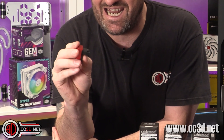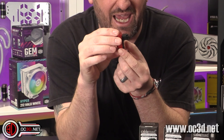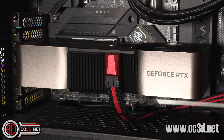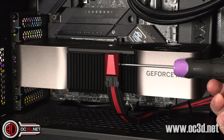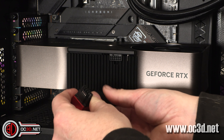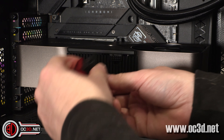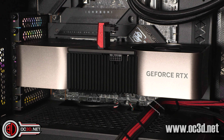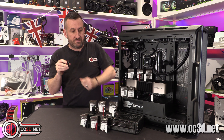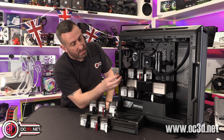You need to make sure that you release that pin or tab underneath. The easiest way I found is to slide a thin screwdriver in the other side, lift up a little bit, and then pull directly out at 90 degrees. The key thing I can't stress enough: don't move and wiggle them too much or start to bend them, because you might break the connector on the card. Just push the screwdriver in, lift it up, then at 90 degrees pull the connector out — that will save the tab underneath from being broken.